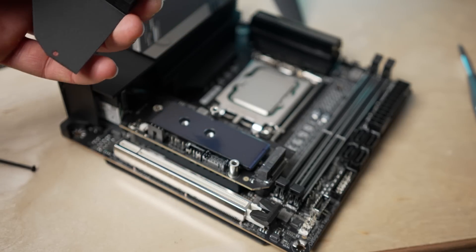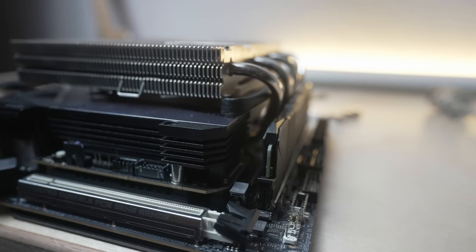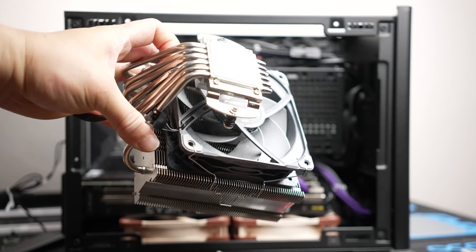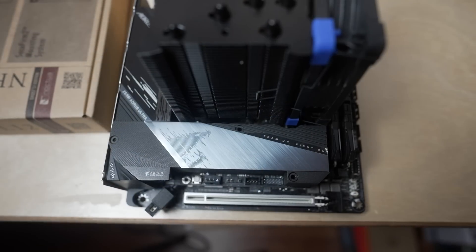This huge chunky heatsink is level with the I/O side of the heatsink, and that's pretty limiting for cooler selection. Most 120mm towers will not clear unless you remove that heatsink — which is what I had to do with the U12A for the 12600K testing. Low-profile coolers aren't a great fit either; Noctua flat out says the L12S or L12 Ghost won't fit, except if you really need to, you could run one stick of RAM and the heatsink will clear that way — but it's totally not optimal. The Big Shuriken 3 needs a 12×12cm footprint and you just don't have it with this layout. A Noctua C14S can work, but you won't be able to fit a fan underneath it. The safest bet for air coolers, if you want to retain this assembly, is a 92mm tower like the U9S, which just about clears without issue.